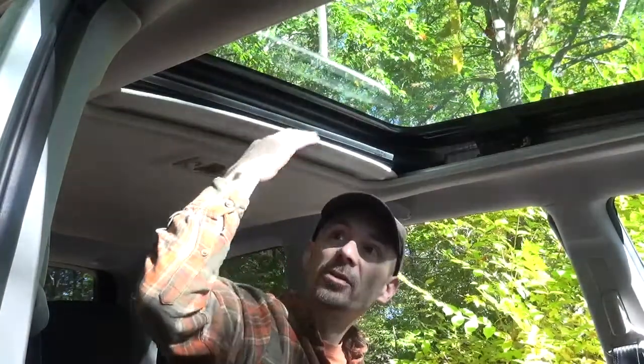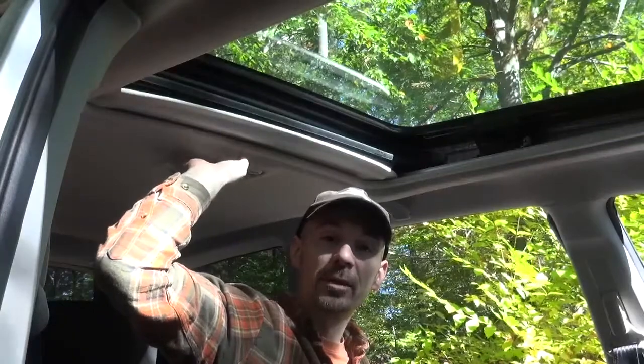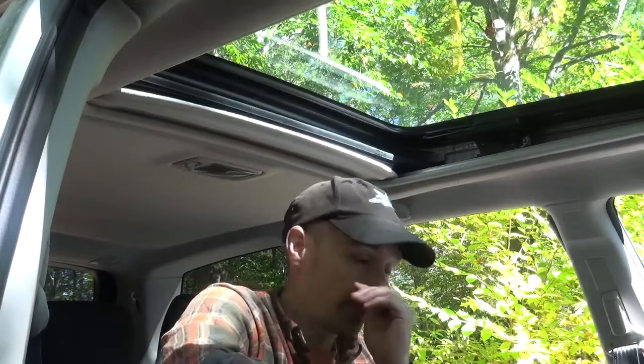Okay, I guess that's pretty much it. Let's get started. As you can see, the sunroof's fairly large. It's a power sunroof. It opens inside, so we're going to have to navigate that when we get inside with the coax cable and we put in the mount. Now, I'm showing you on this vehicle because this is probably a bit more of a challenge than most installations. For most NMO antenna mounts in most vehicles, especially when you're mounting 2 or less of these mounts for an antenna, you won't have to actually remove the headliner or even take it down.